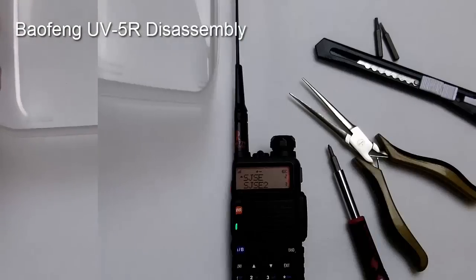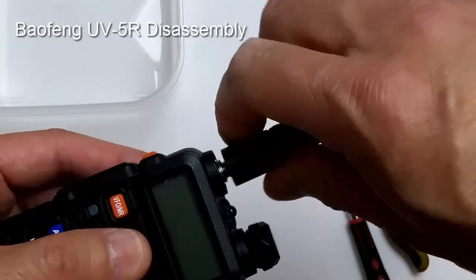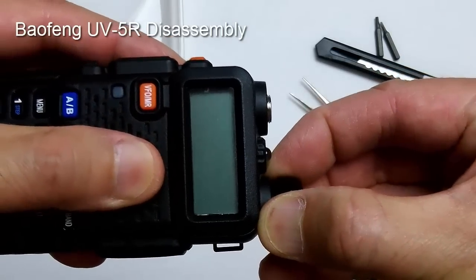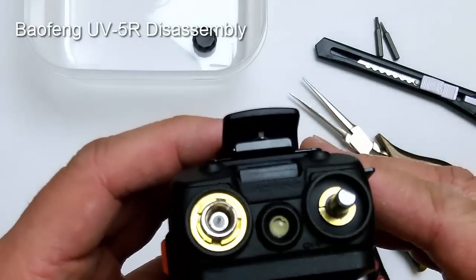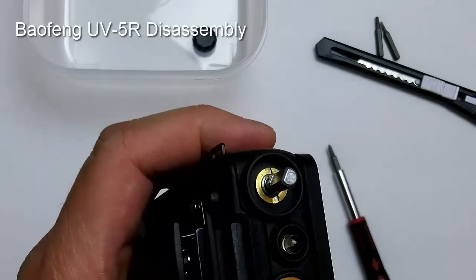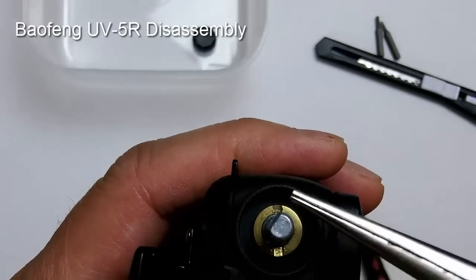The first thing you need to do is turn off the radio and remove the antenna. You also need to remove the on/off and volume knob — basically you pull it straight out. Now you need to unscrew two small thin nuts. The first one is for the volume control and on/off switch. There is a slot on each end, and since you have the knob here you can't use a large screwdriver.